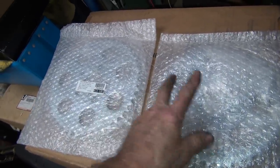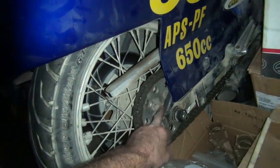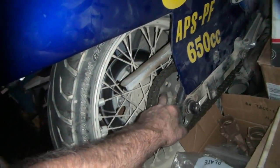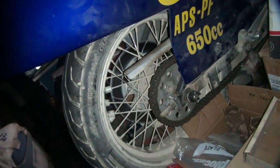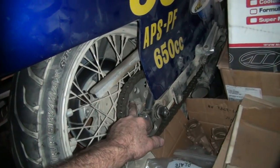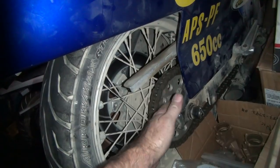This has a 200 offset, it has a 150 offset I think. So you're going to have to have at least another 200 offset — a quarter inch. They do make a quarter but I don't want to make a quarter that has the flange support in it. Now you can buy this sprocket FXR 46 tooth for an FXR in this diameter. You're a 48 so you're only dropping a couple teeth — halfway between these two here, just a three tooth difference, about the width of my fingers. So when you get back home you're going to have to look at your sprockets. If you can go down to something like this, it's basically about three and a half tooth to one on the front.